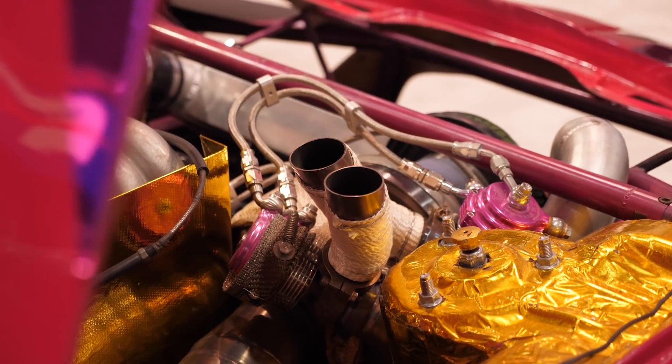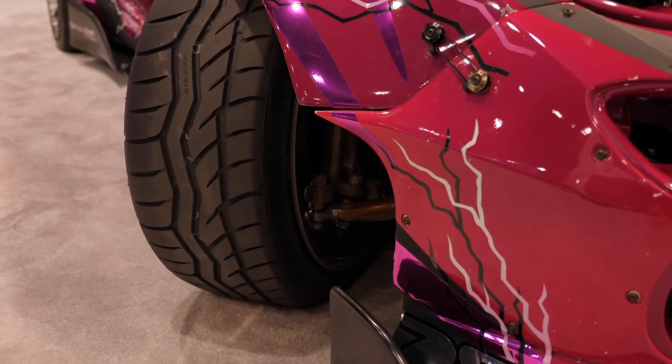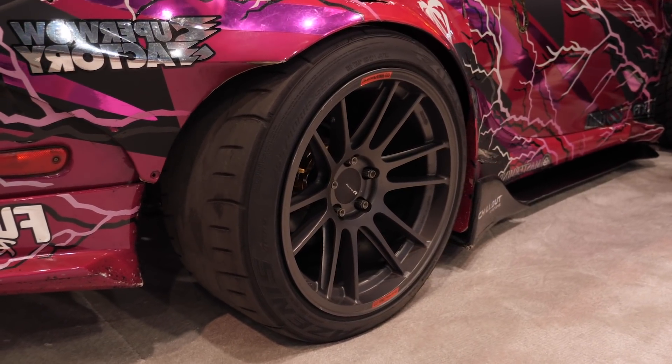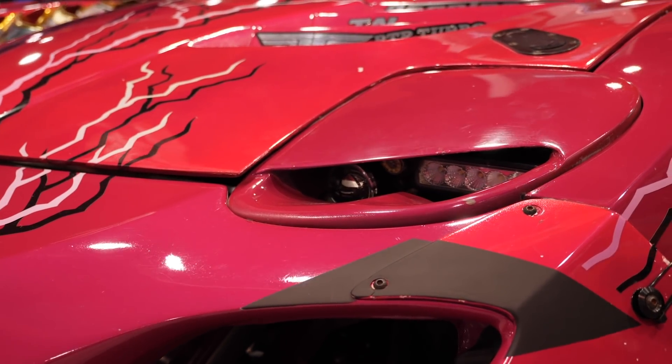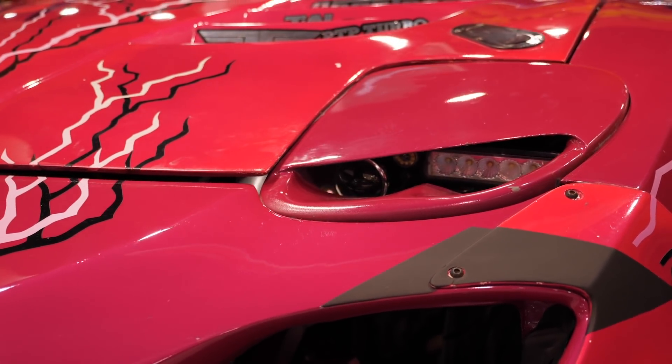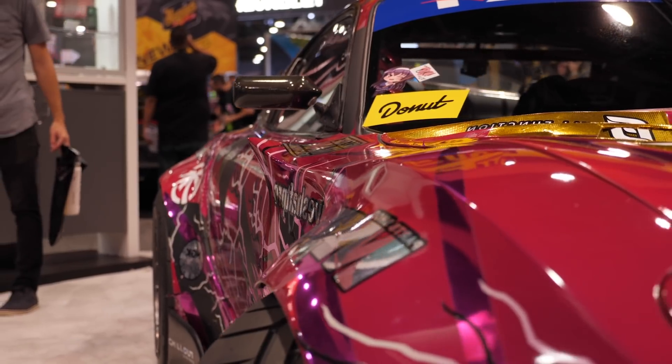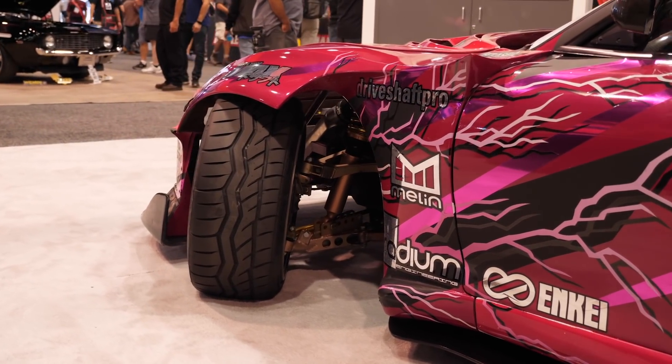If chasing very high RPM power, the holy grail has always been the full peripheral port. But with a large peripheral port, you destroy bottom-end power, and drivability becomes a concern. In drift, if you're off-throttle in a corner and revs drop, getting back into the power range puts you at a disadvantage. A guy with a blown V8 has twice the torque and horsepower at three thousand RPM while you're making nothing. At the end of the day you have a small-capacity engine, so you've got to make everything work for response. This semi-peripheral combination gives essentially the best of both worlds.